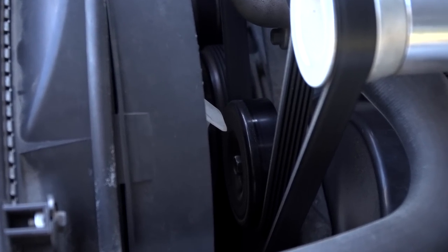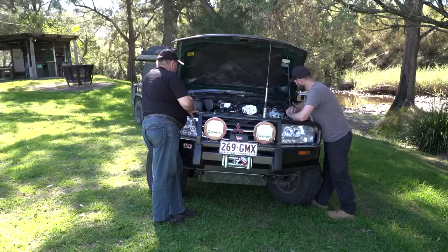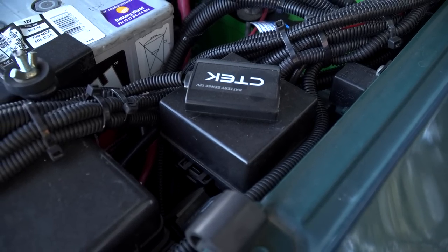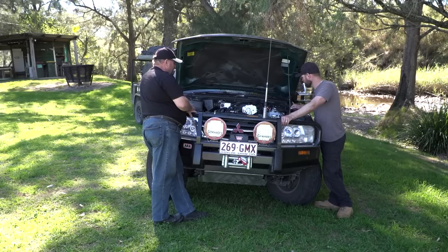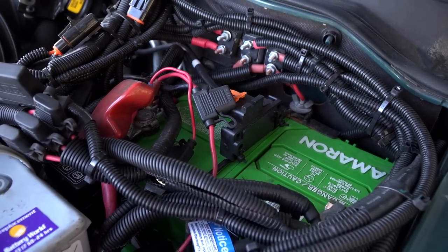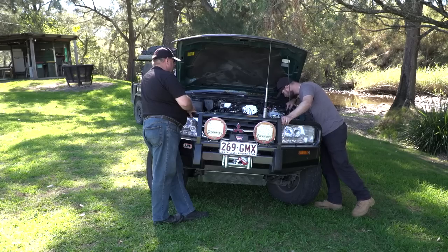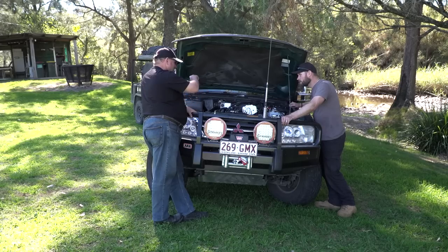Let's finish the supercharger and air intake. The air intake didn't have to be modified — we added the Unifilter, of course, and there's a Safari Snorkel, but all the intake is stock. The Bullet guys take care of the modifications to fit the supercharger and replace the intake manifold. It is a bolt-on kit — you can buy the kit and do it yourself. You need a tune obviously, and there's a piggyback computer. The Chip Torque guys do that and they're all over Australia. Also a longer serpentine belt with a couple of pulleys changed.